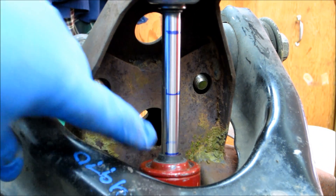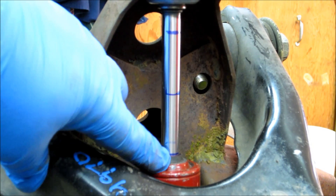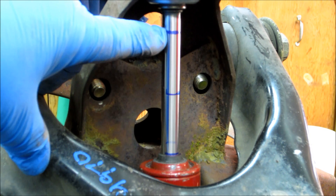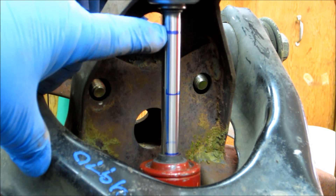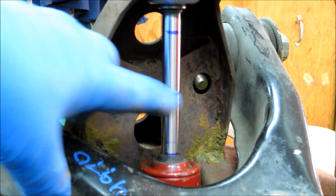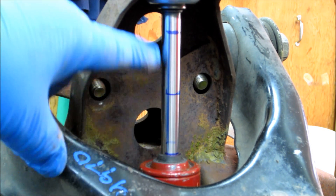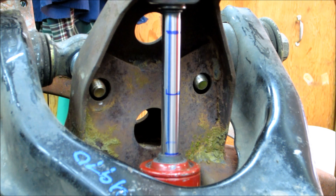Just a quick flip here. We're down at the lower travel right now, on the bump stops. I put a line there — this is basically where the upper travel limit was; there might have been a little more room than that. I put a mark here when I had it set at ride height, drew a line just like that above that rubber seal right there. So if you look at that, we are just almost perfectly in the middle of shock travel. I couldn't really get any closer than that.